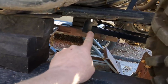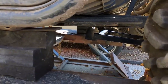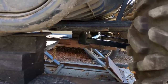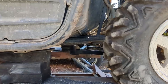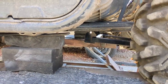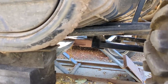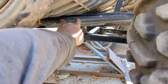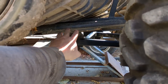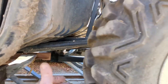So you can see those little tabs right there. Easiest thing to do would just be weld two little tabs on there, put a bolt through, and be done. The problem with that is when they hang down, when you actually go take this thing riding off-road, you're going to drag those little tabs on everything and it's for sure going to hold you up on something. Like a lot of other things I've done, I actually want to make a bracket — take a piece of angle iron and run it across the entire bottom and then weld two little tabs on. Then put tabs on top of the angle iron to bolt into the side here and possibly back to a crossmember. So to take this whole plow off, you just remove two or three bolts from the side without crawling under it, and the entire thing will drop down with its little bracketry and slide out.